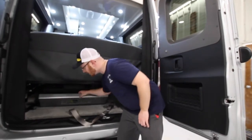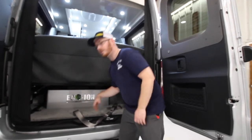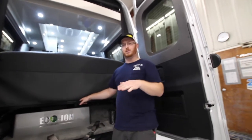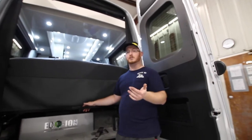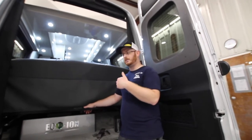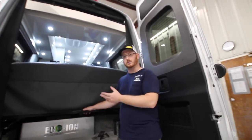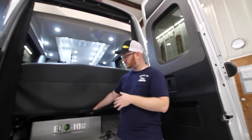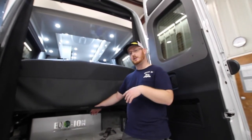If it's winter, I'd also have that solar disconnect off, because once you have snow coverage on top — effectively knocking out the solar panel — it'll eventually become a draw on the battery. So when you come back next year, it's not going to be charged. Make sure you turn that off if it's wintertime and you're not going to be using the unit for long periods.